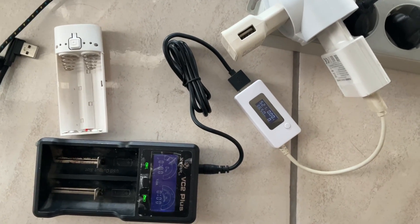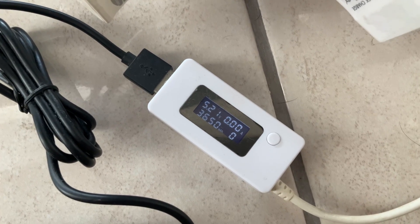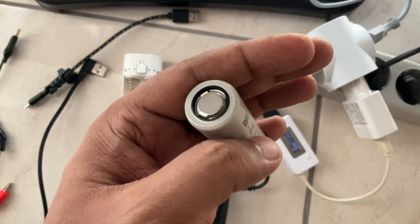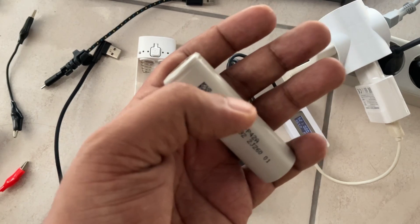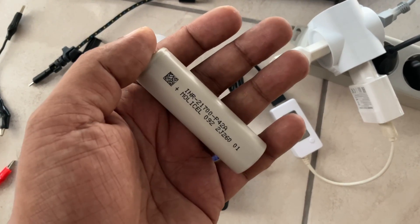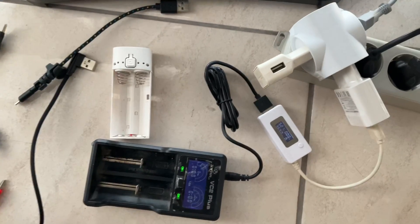So after starting from three percent battery remaining, the measured capacity was 3600 milliamp — which means it's more than 4000 milliamp total. Reducing to zero percent is not ideal for battery health, so starting from three percent is fine. The last two to four percent actually holds good capacity. That's my review — the battery is exactly as they claim, so I'm satisfied. Hope you like the video, see you!